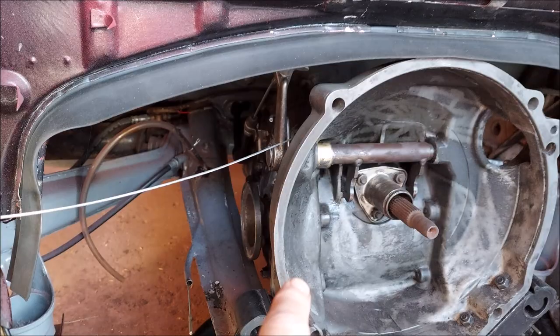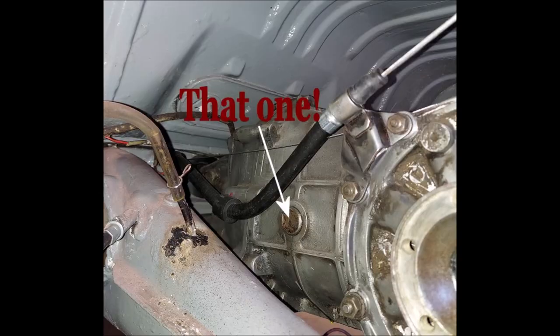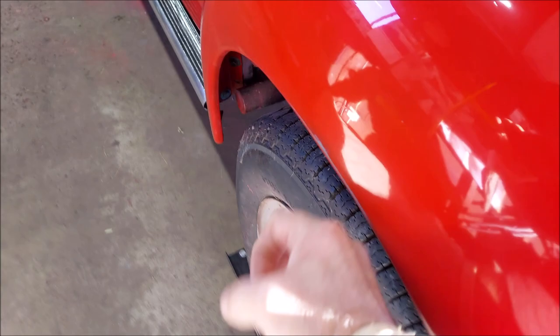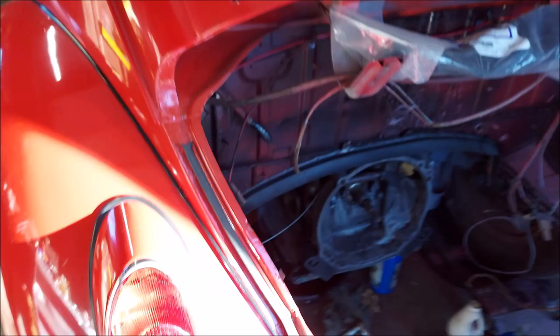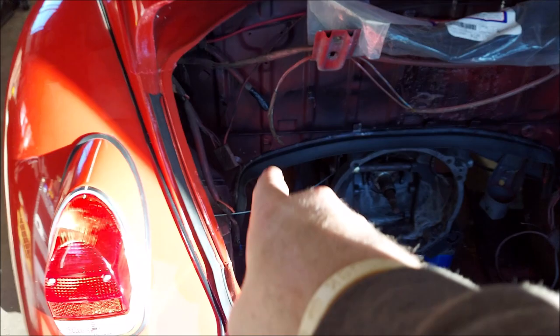If you have to do this from outside the fender well, which you can do because your motor will be in and everything, take a rubber hose and run it through the fender well down into that hole. The rubber hose sticks up on the outside and you can put your gear lube in there. When you're putting it in, if it starts to overflow out where it's filled, remember you still have a lot in that tube, so get your thumb on it and pull it out. Hope that helps a little bit.